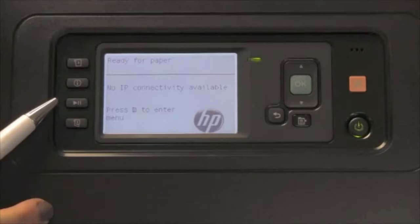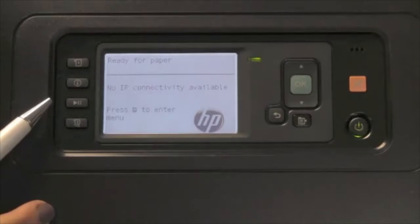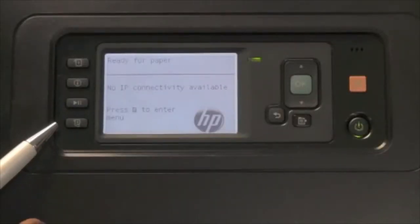This paper info key is valuable and unique to the DesignJet Z6200. When you press the next key, it will complete printing the current job and then pause in between prints. While paused, it will allow you to load a new roll of media. That's important in production because you can have a long run and don't want the printer to run out of paper. The last button is a form feed and cut button — it will advance media about three inches and make a cut.